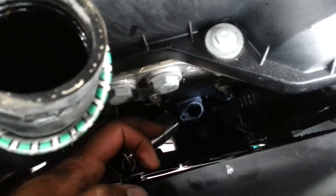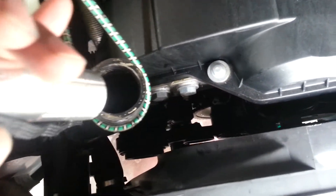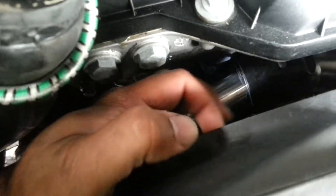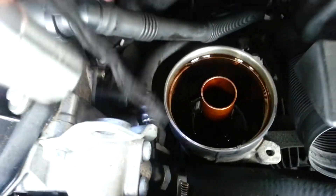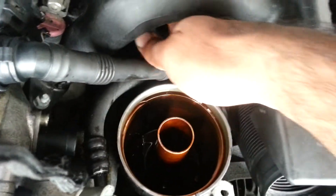We are doing the crankshaft sensor today. You can see here it's at the front and it is a bitch to get to. What I've had to do is take apart the radiator hose — obviously had to drain the radiator first. Took out the radiator hose, clamped it up there so it wouldn't flop back, connects up here to that flange. Then proceeded to this side, took off the solenoid, and took off the oil filter so I could get my hands down in there.